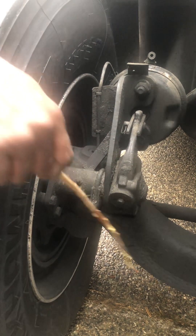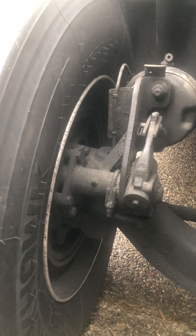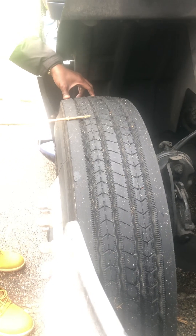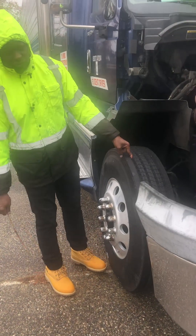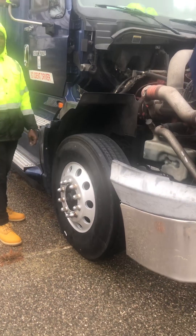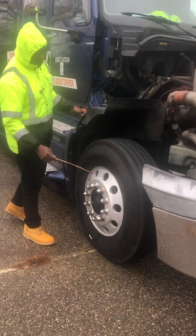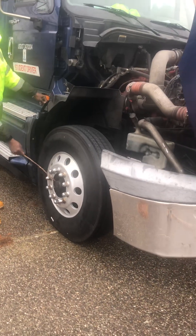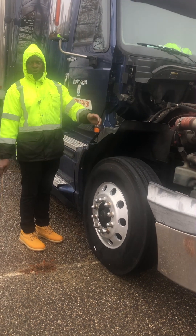I'll check the inner wall, top wall, and outside wall of the tire for abrasion and bumps. The tread depth should be no less than 4/32nds of tread - it should be at least 4/32nds. I detect no abrasion or bumps on it. I'll check my outer rim - mounted and secured to the vehicle, not bent, broken, or cracked, no illegal welds on it. I'll check the inner rim also. Then I'll check my lug nuts - mounted and secured to the vehicle, not bent, broken, or cracked. I detect no shiny metal or rust trails that would indicate looseness. I'll check my hub oil seal - mounted and secured to the vehicle, not bent, broken, or cracked. I detect no leaks.